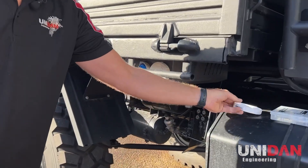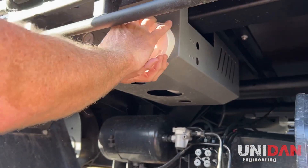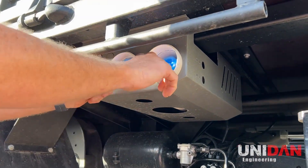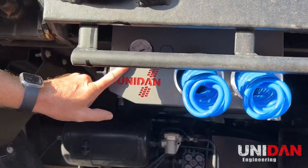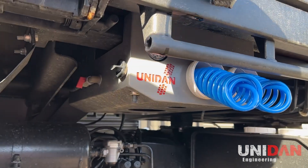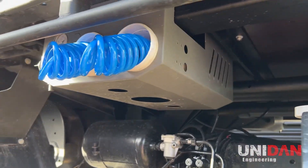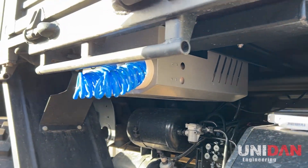It's a little bit of a spin-off of the Central Tire Inflation. Our Rapid Tire Inflation is a system that has two boxes, one on each side of the truck. Each box has two coil hoses, a pressure gauge, a tap for inflating and deflating, and a few other little key bonuses. You can also add a cigarette lighter, USBs, and 50 amp Anderson plugs for solar in and power out.